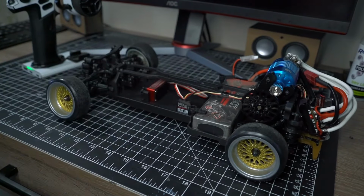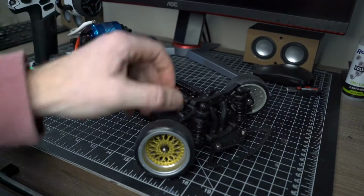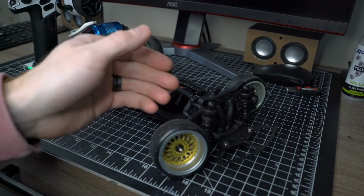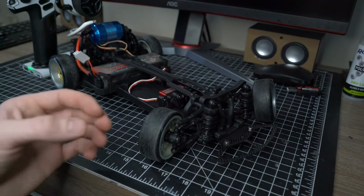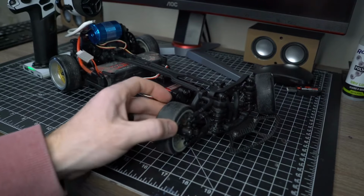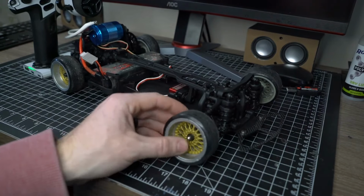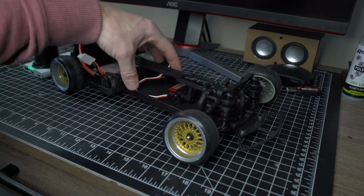The shocks feel good. The overall build was simple, straightforward, just like any other Yokomo build that I've done. The angle seems pretty good. I did give it a quick bench alignment. Didn't measure the toe, but I measured the turnbuckles to give it what looks like maybe just slightly toed out. But yeah, the Ackerman and the steering all looks good. Again, haven't checked caster, checked both cambered just to make sure they were the same before I set toe.